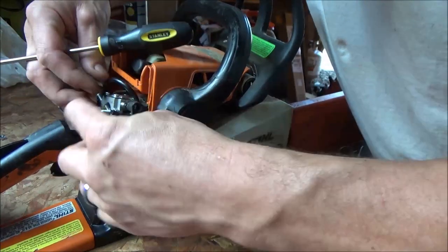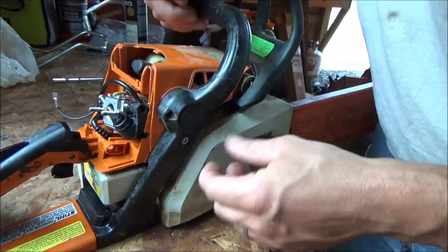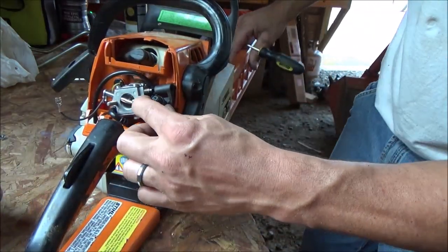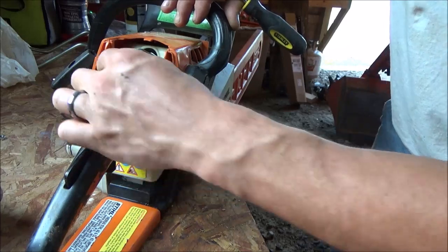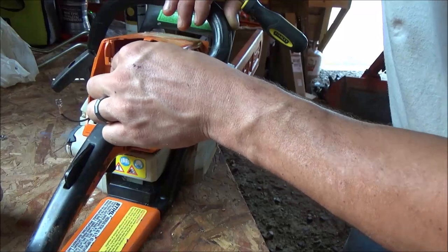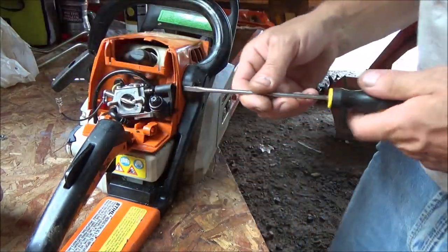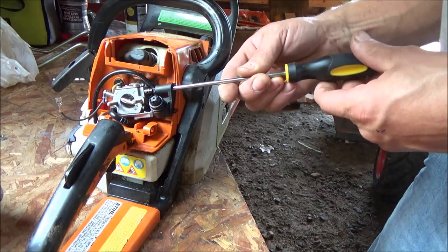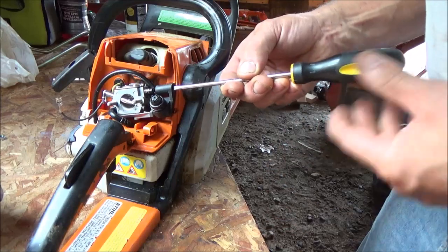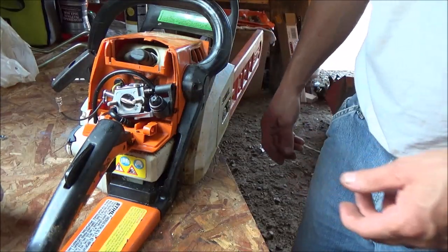So what I'm going to do, I was thinking about modifying it, but I'm hesitant to, simply because if I've got to repair the old carburetor, because this one doesn't work for whatever reason, I don't want to have to buy this piece again, because of negligence, or just due to the fact that I cut it. But you can easily enough reach through, you get to the high speed side of the carb, then you just tip it a little bit, we can get to the low speed side. So we're just going to go through the one hole, hit both screws, call it a day.